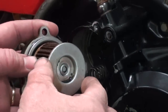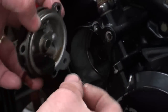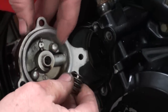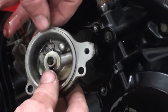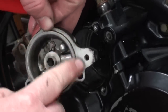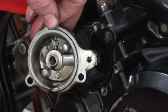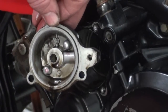Once you get this cover off, what you're going to find is the old filter, which you're going to discard. A couple of things to watch for: you've got a spring here that keeps the filter pushed up against the front of the filter body, and it usually falls right out, so be sure to retain that for reinstall. There are also two O-rings on this cover — a perimeter O-ring that seals the main body, and a smaller O-ring that fits right in the crankcase that seals the little outlet tube. Be sure you don't lose those. Inspect them and make sure they're not cut or damaged, and if so, replace them.